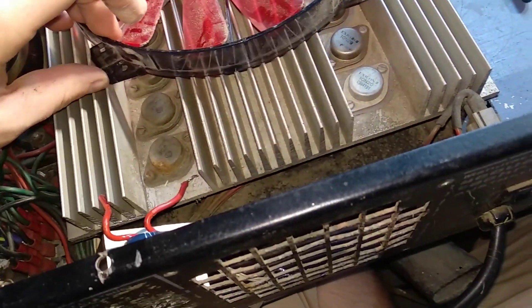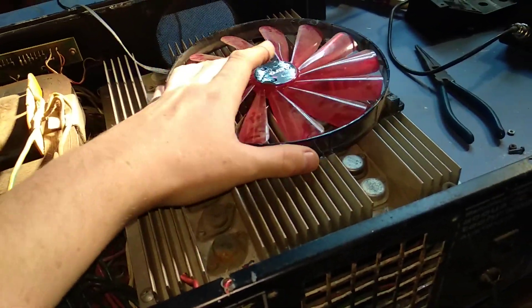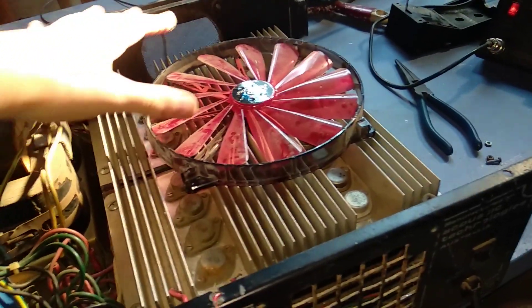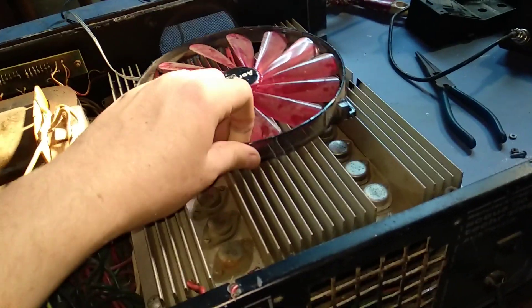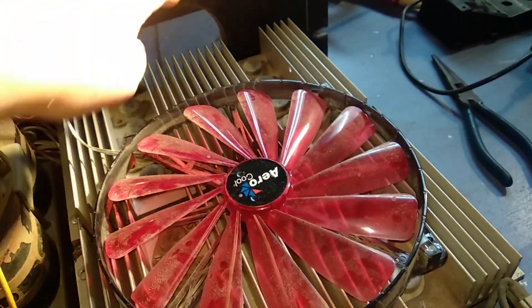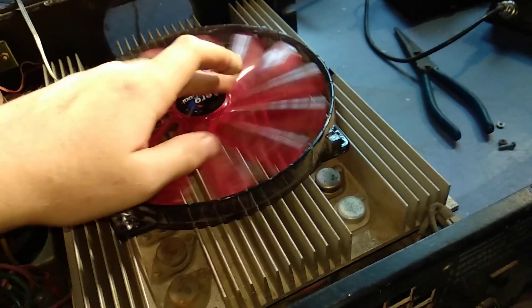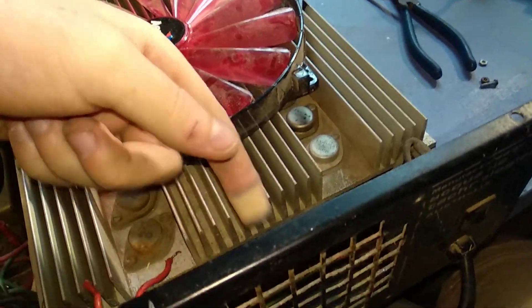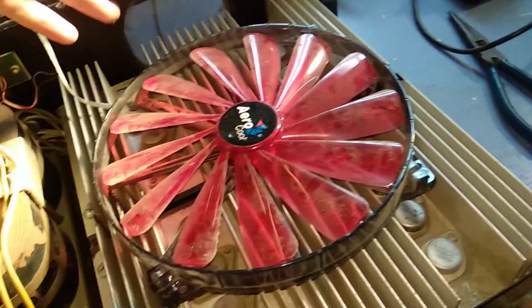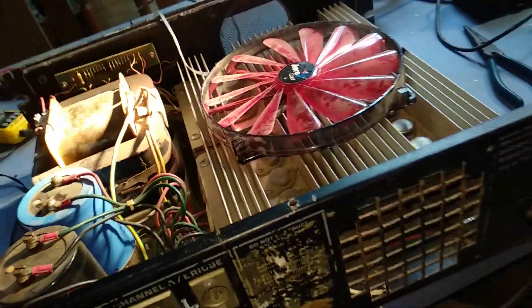As for this mount, I had a think about where to put this on the heatsink — whether to put it near the side where there'd possibly be less airflow, or whether to put it close to the front as these fans are going to be drawing air through the fins, or whether to pull it near the back so the intake isn't fighting the air coming out. I decided just to put it right in the center so this airflow can streamline in, and in case there's buffeting we've got two fans providing twice as much static pressure as one fan, which should bring air through regardless.